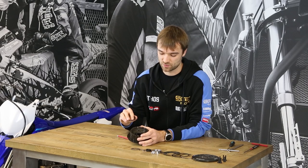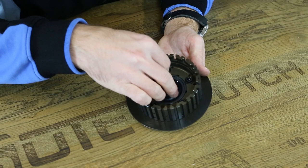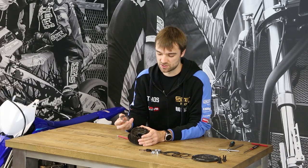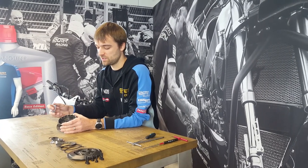The next part is the release ring, which carries the BTL spring in its diameter in here. The BTL spring is a small disc spring which is available in different forces. The stronger the force, the more engine braking you get.